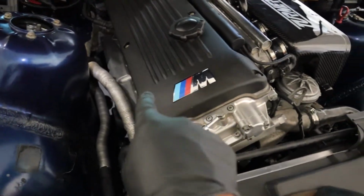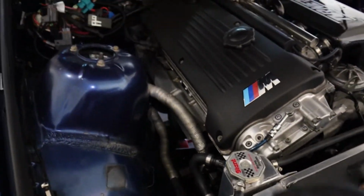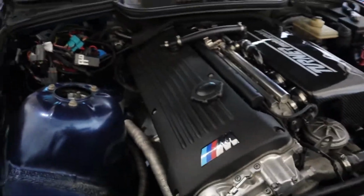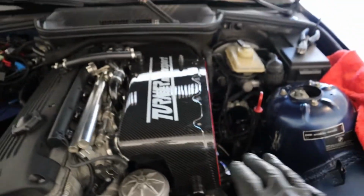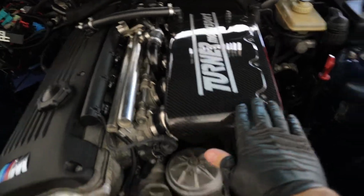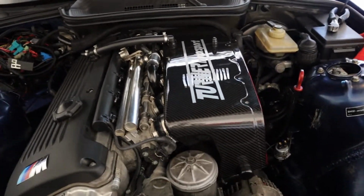Now I can jack the motor up more. I'm speaking fast because I already have the motor jacked up, so I can pull that engine mount. So I'm gonna do that while it's jacked up. All right, boys, update. Both mounts are now in, and I can start to put the intake back together and then put the strut tower brace back together, and everything should be good.